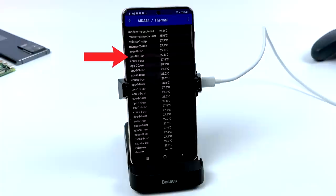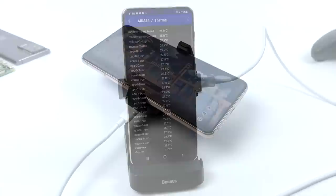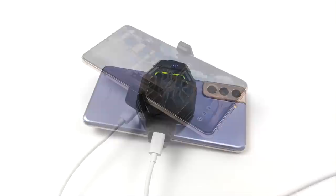After just a couple of minutes, we dropped from 32 degrees Celsius down to 27 degrees Celsius, and the longer you go the cooler it gets. It's not only cooling the CPU — it's also cooling the battery. If you play games while charging, your phone gets a lot hotter because the battery heats up everything inside, including the CPU. When the battery gets hotter, a sensor tells it not to charge as fast, so you charge at slower speeds. The cooler keeps the CPU at maximum clock speed and keeps the battery cool enough to charge at its maximum rate. The one major drawback is that you have a giant fan and heat sink attached to the back of your phone, which can make it cumbersome to hold.